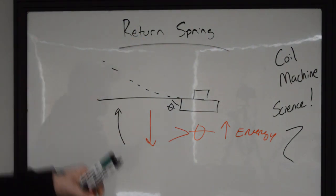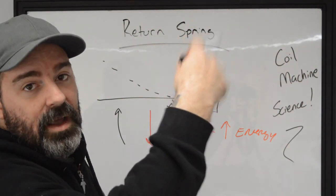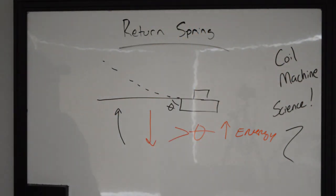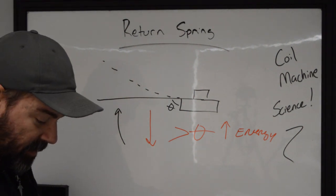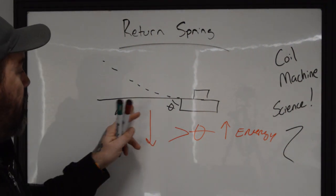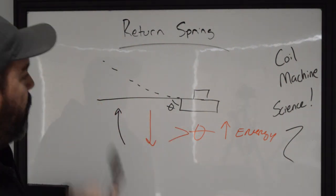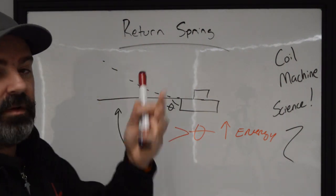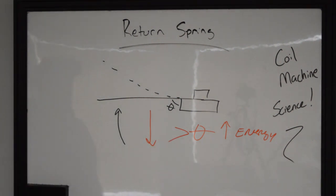There's only so much effort that we can do with that front spring by dropping it down in relation to where the A-bar is to actually allow the movement, which will just screw with the timing. It's not going to make it run very well. So there's always a sweet spot for everyone based on geometry, which we have a video about, and the actual tensile strength and construction of that rear spring as to how it's going to be moving, and that's going to be up to each individual with whatever their setup is going to be.